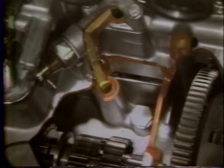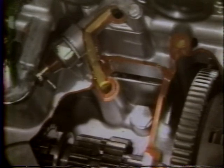If the oil filter does become so plugged that it will not allow any oil to pass through, oil pressure will force open a bypass valve. This will allow dirty oil to go around the filter into the engine, which will increase engine wear if prolonged, but dirty oil is better than no oil at all.